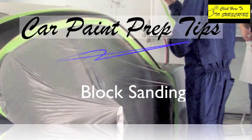Another tip when block sanding is to use longer sanding strokes. Don't do real choppy short strokes, because after it's painted, it may give it kind of a choppy appearance. So use longer sanding strokes, and continue to use the cross sanding method. That helps level, to assure everything's good and level, and there won't be any wavy areas that are not noticeable after the car has been painted.